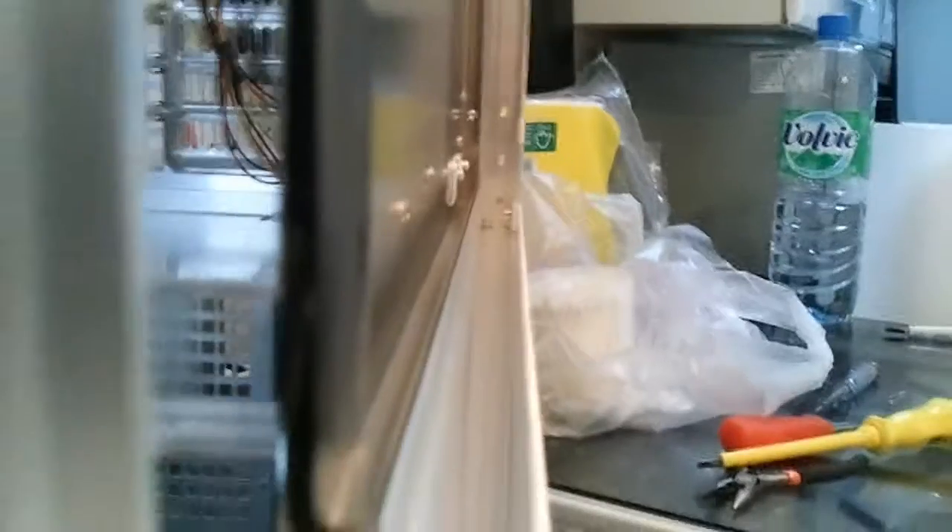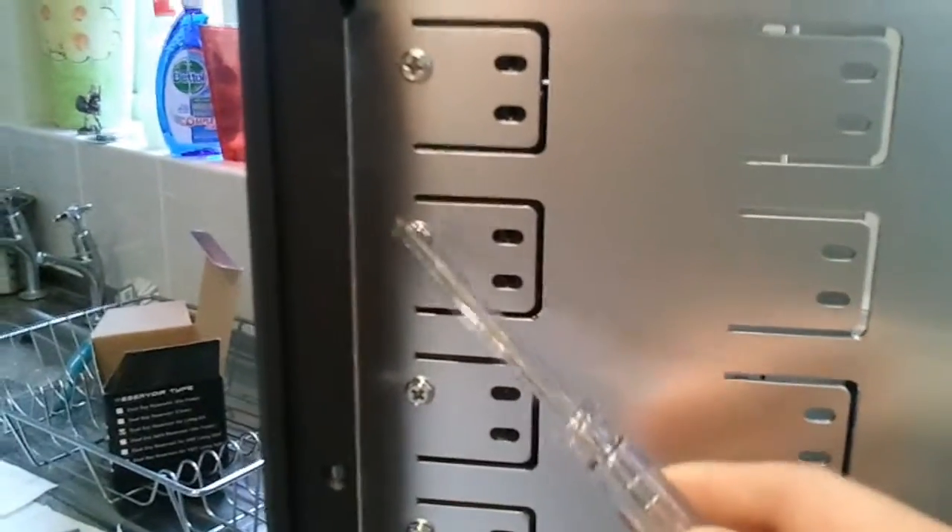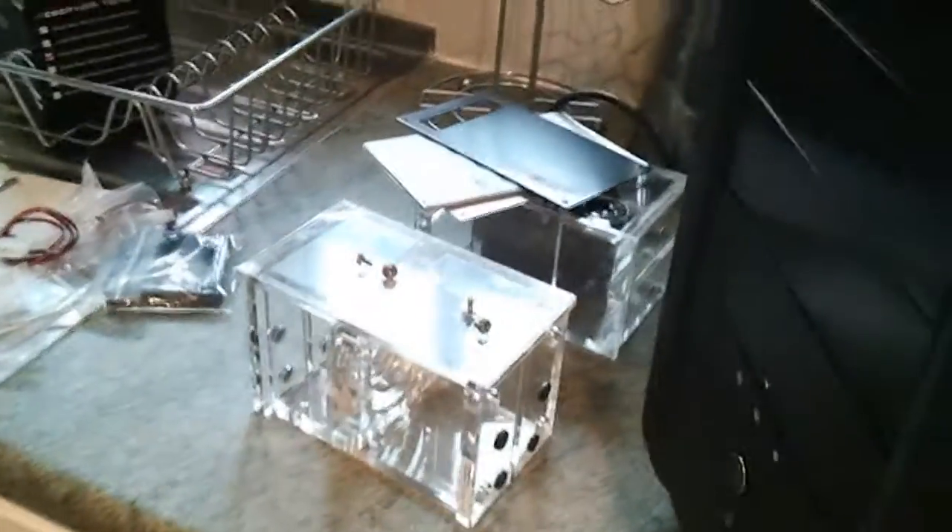After taking the other side panel off, there's something else I thought I should mention — cable routing in this case is going to be a breeze. Just down here there's a very fine space between the back of the motherboard tray with its cutout and where the side panel will go. There's a good maybe an inch gap for hiding away all the cables, because I am a tidy cable freak. You shouldn't have cables on show, especially where airflow is concerned — you want nothing blocking it.